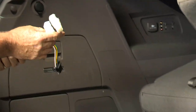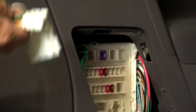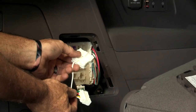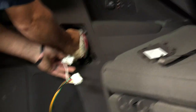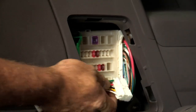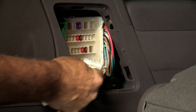Honda did a really good job at prepping the vehicle for towing. We've got two connectors here that are going to plug right into a fuse panel. I'm going to use a flathead screwdriver and take that off to show you right where we go. We have two connectors that plug into this fuse panel. The white connector will only be used if the vehicle is equipped with reverse sensors — the easiest way to know that is the plug we're going to use for towing will already have something plugged into it. This one doesn't, so we're not going to use the connector with the white wire. We're just left with this one connector — we'll go ahead and plug it in; it clips right in.